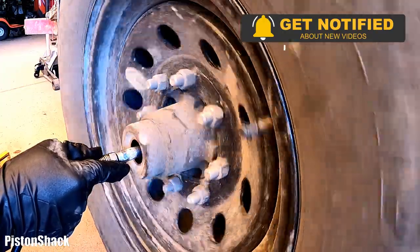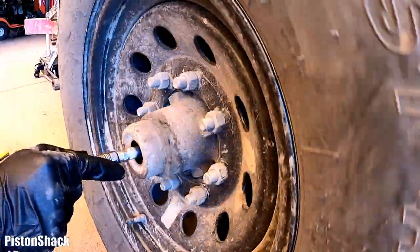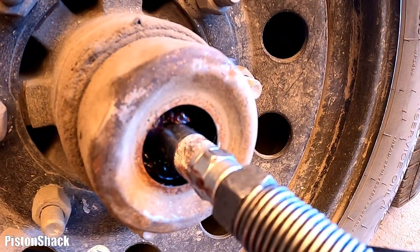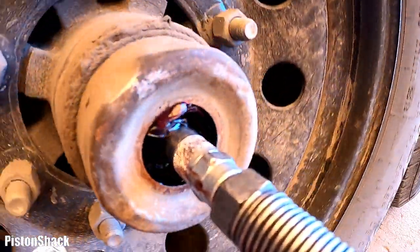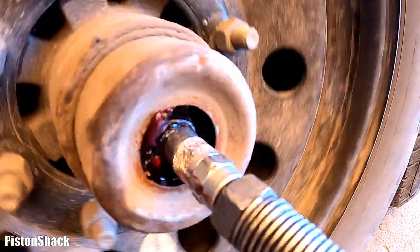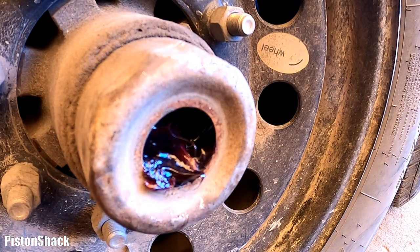I'm using EP2 wheel bearing chassis lubricant — today I'm using Chevron Starplex EP2 grease, a very standard type. I've sped up the video; if you have any questions, put them in the comment section below. As you can see, all the old grease started coming out slowly. I keep pumping and rotating the wheel.